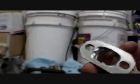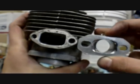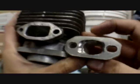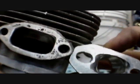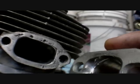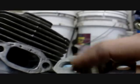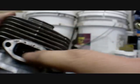One thing you could do also, this is the mount for my exhaust. Port it so that it matches the exhaust port. Now here, as you can tell, the size is different. One of them is rounded and one of them is rectangular. So I couldn't ultimately match it so that it's identical, but I did my best to get it as good as I can possibly do it. Now what you do is you take little bits, attach it to the Dremel, and just match it up to here.